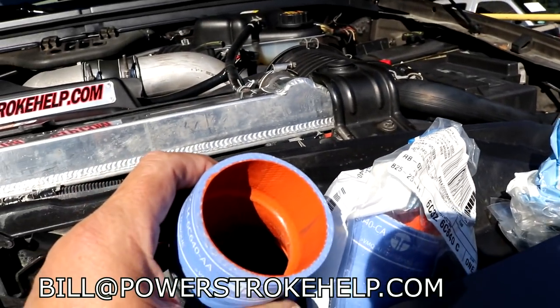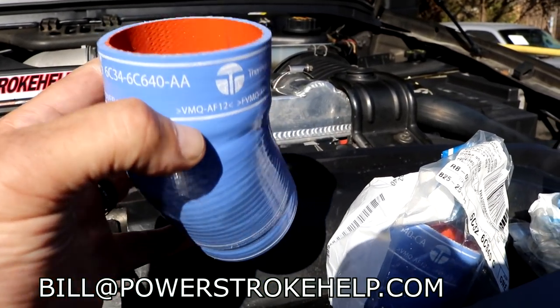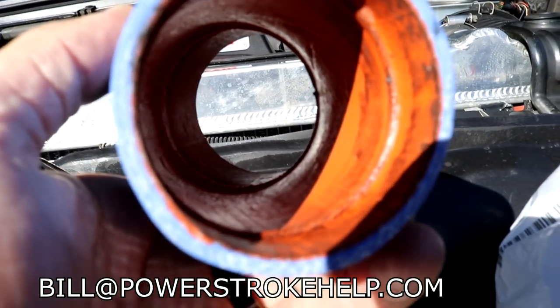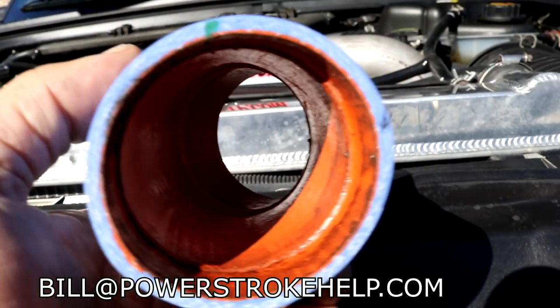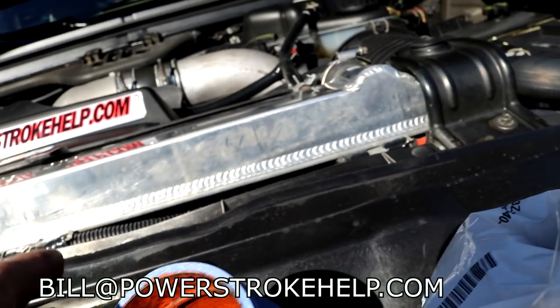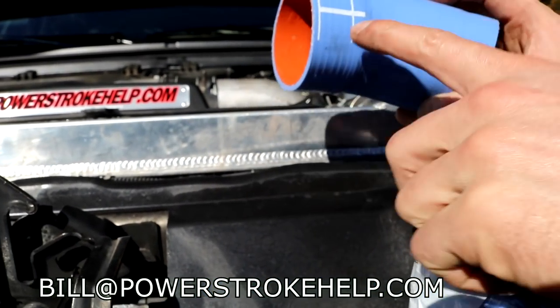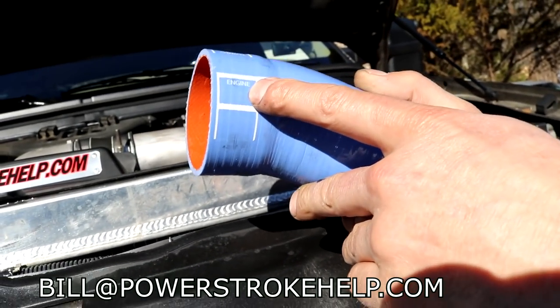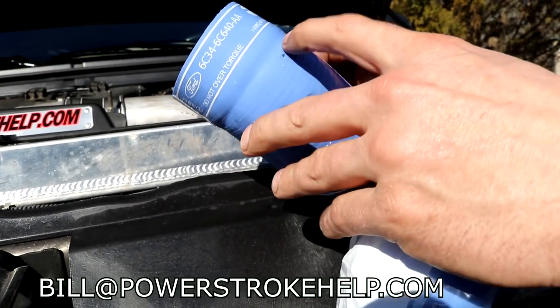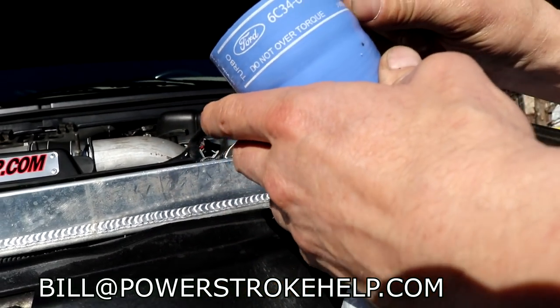Most importantly, make sure that you install it correctly. Don't put the groove side towards the turbo. The groove side goes towards the tube. It's really important that you install it correctly. I can't tell you how many of these we've seen put on backwards and people complaining about it. No, I don't know what happened. Well, you didn't know what you were doing. That's the problem. Loosen up behind, right, the wrench. And the clamp needs to fall... I mean, this is very self-explanatory. Engine side, do not over-torque it. Do not under-torque it. Clamp needs to fall within this band range.